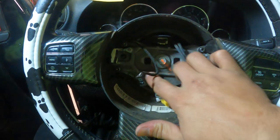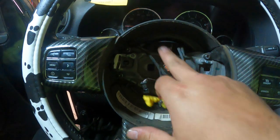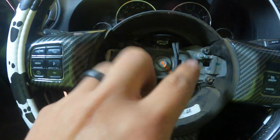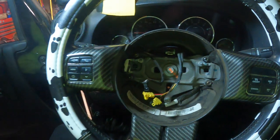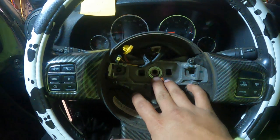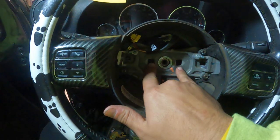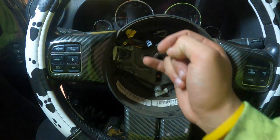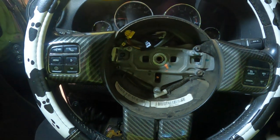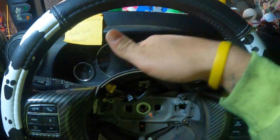With the horn off, you have what I believe is a 13mm nut, and then this plug which I believe is for the steering wheel controls. Make sure you mark or remember how this is positioned so you can get it back on as straight as you can — that way you don't have to go get an alignment. So let me get this off and unplugged, and then we'll get a steering wheel puller. It needs to go in these two squares, hooks going outwards, to push on the center and pull the steering wheel off. Once that's off, we'll work on the cover over the clock spring.